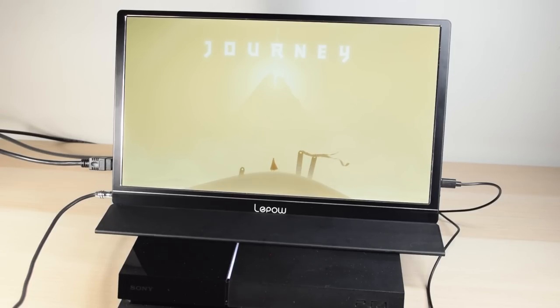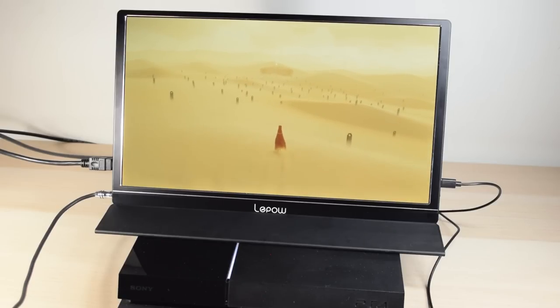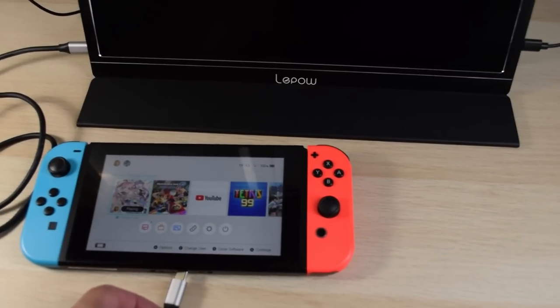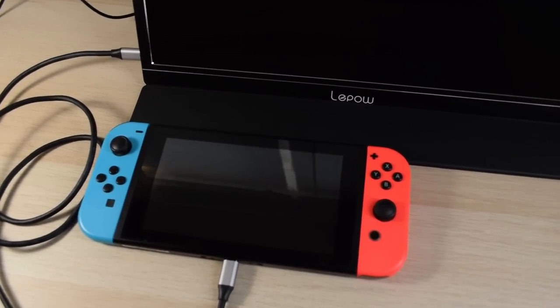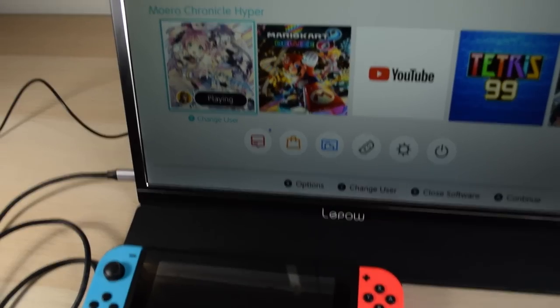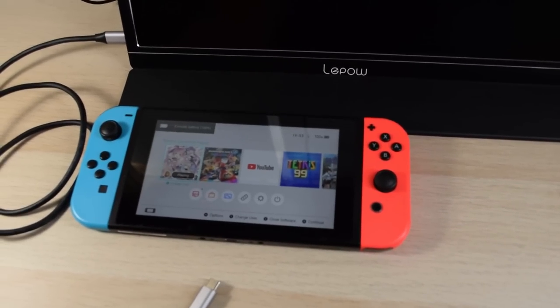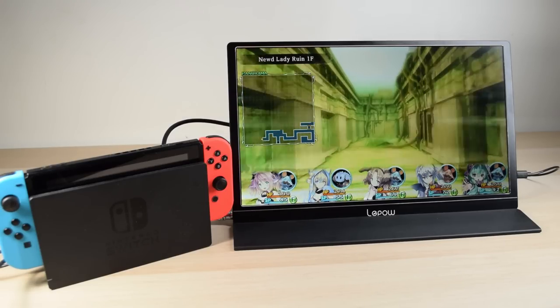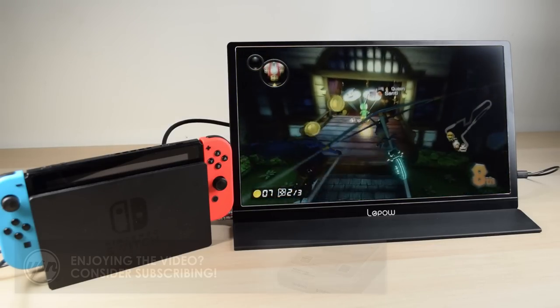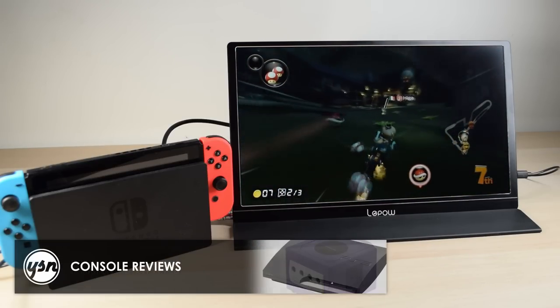Let's talk about a Switch setup first. Since the Switch Lite lacks the internal hardware needed to output video, you can only use a regular Switch. There are technically two ways you could go about things. You can connect the Switch without a dock via a USB-C cable to the left USB-C port of the monitor, then connect the right USB-C port to power — that will work and give you an image on the screen, but that technically makes the screen a dock. Since there's this whole third-party dock causing bricked consoles thing, I personally wouldn't use that method, just in case. I'd rather just use the dock: Switch in its dock, HDMI for picture, and power from the dock's USB port. Easy and simple. While not as compact as the no-dock method, it gives me peace of mind that it's not going to break my system.